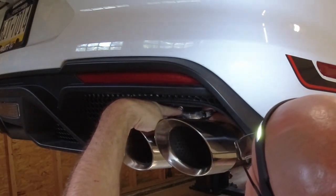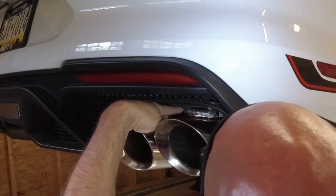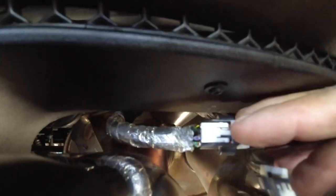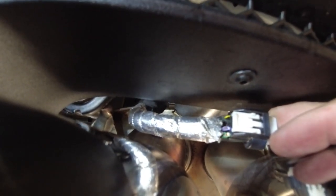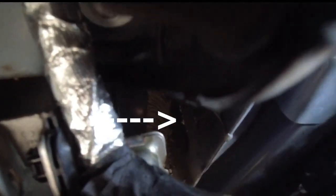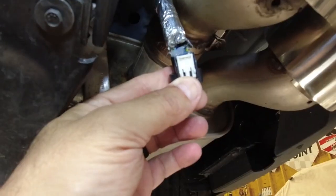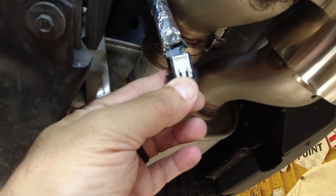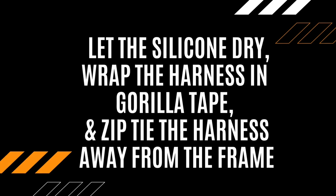And there we go. Son of a bitch — why these guys can't get this right is beyond me. There's my harness, you see that white tab there. If you look closely at the harness — the wires are frayed because it's hitting the frame. The car has 3,000 miles on it; this really shouldn't be an issue. I haven't touched this exhaust system at all. You can see what the issue is — the frame is right where the harness is. I pulled the harness down, applied some silicone — basic silicone — but that should insulate it and fix the short.